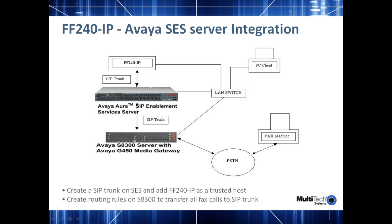The next application is the Avaya SES server integration with the fax over IP server. We do have app notes available on how to configure the Avaya SES and the fax over IP system. What you would want to do is configure SIP trunks rather than trying to do this as a SIP endpoint with registration. A SIP trunk is a much easier way of configuring, allowing you to forward any incoming SIP calls into your Avaya system to the fax over IP device. Likewise, for the fax over IP system to forward SIP calls to the Avaya system.